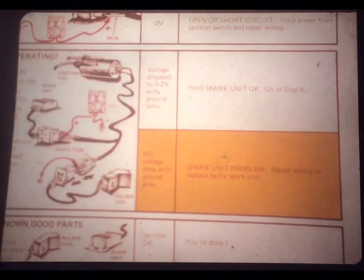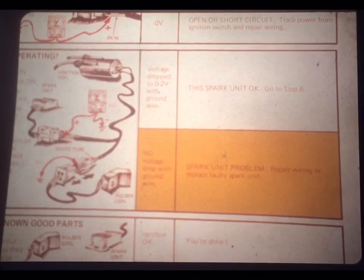Then at the pulsar connector, Joe touches his ground wire to the harness wire coated with a white or light yellow tube. This is part of the pulsar loop. Now the spark unit thinks there is a pulse. The switch closes, and the voltage through the voltmeter should drop off to almost nothing because the primary is now properly connected to ground. The circuit through the spark unit has less resistance than the circuit through the voltmeter.